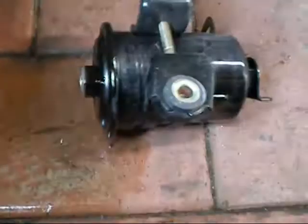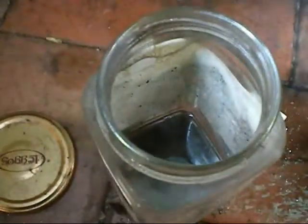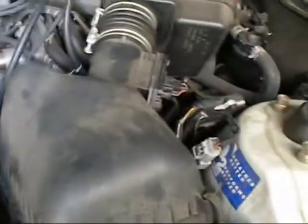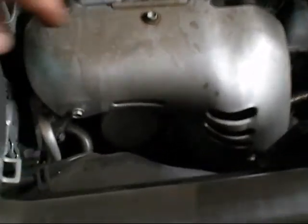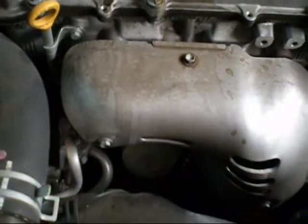There's a fair bit of resistance there. Good call — I just guessed that it needed one. I bought it all before I picked up the car. All that's back together again. There's a fuel filter down there; I just find it easy to take a light off. Time to do the oil filter. It's a prick to get the tool in there unless you've got the claw — sometimes hits the suction line on the aircon. Most oil filters I just grab the bloody thing as hard as you can and start twisting. If you're strong enough and the prick before you hasn't tightened it too much — there we go, it's loose. Easy as that. You just tighten it by hand. Don't reef it up, otherwise you'll never get it off again.